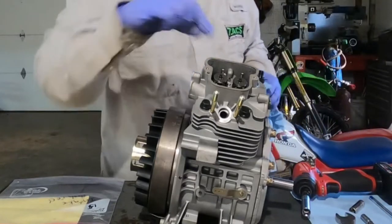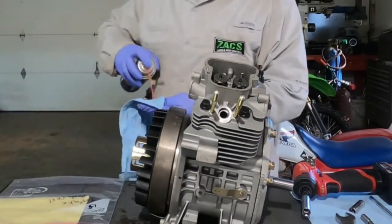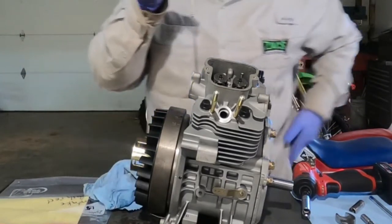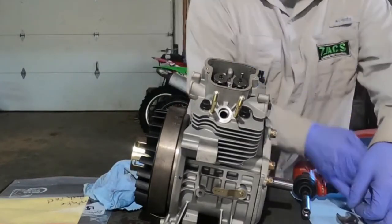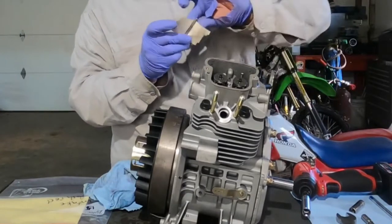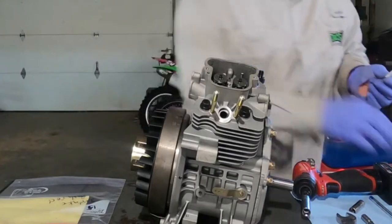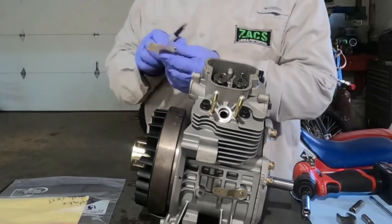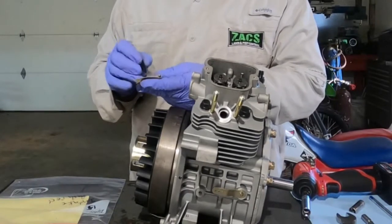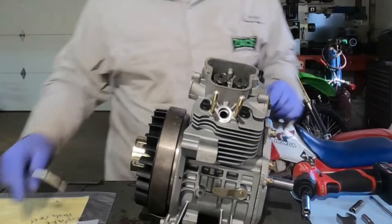The reason you want to do that: I'm taking the intake side out — just pull it straight up. I take a little bit of brake cleaner and rub it off. Make sure you know and keep oriented which way was up. If an engine has run in, these things do bed in to the lifter side and also to your rocker side. So take the permanent marker and write — rocker, intake. Peel the tape off, throw the rod back on, clean it, and throw it back on.